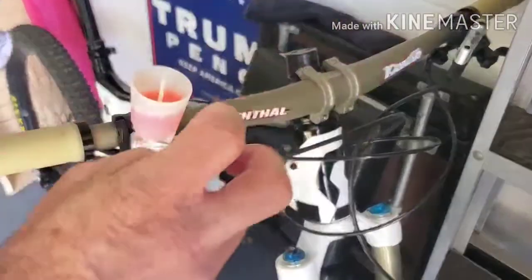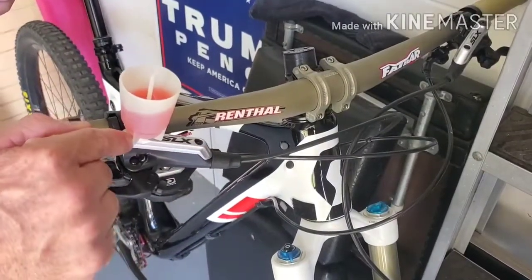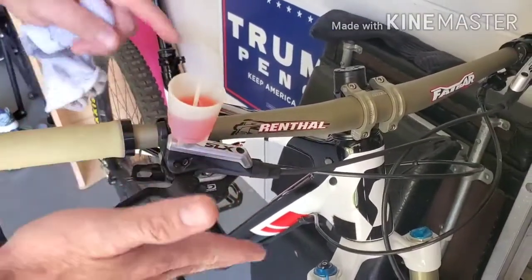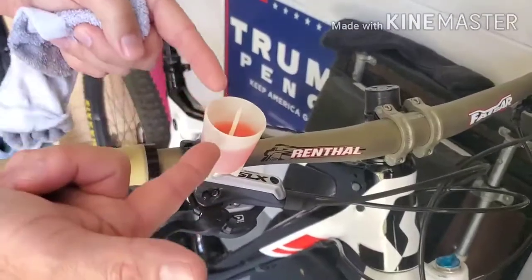What is that? It's going to be to burp it. It's going to be to go ahead and remove your cap, put on the cup — the Shimano cup, because it's a Shimano brake. And notice I'm not angling anything. I just want to get some fluid to the high point.